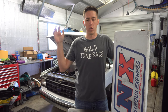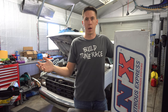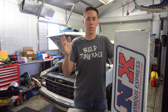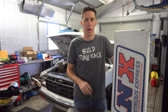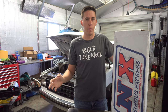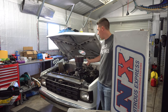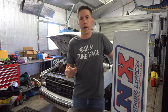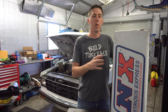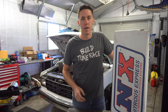It just doesn't have enough power and torque to pull through there. But in a static burnout with water and everything, like we did at the Ice Cream Cruise, no problem - pulls right up through there, 7,000 RPM burnout, high gear, no issues. So just lacking a little bit of power in that mid-range. Got some nitrous for it - 4150 style throttle body EFI, going dry. This is something I've been wanting to play with - dry nitrous tuning.